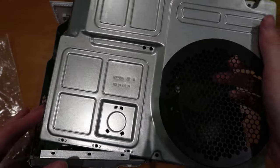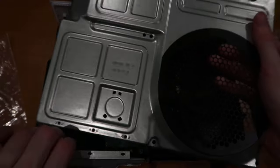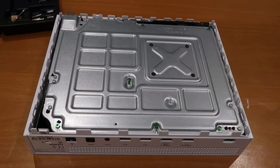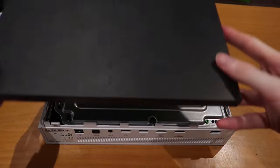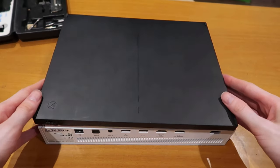Put your Xbox back together — basically undo what we just did. Don't forget to put all of the screws back in. Once reassembled, clip the plastic case back on using a bit of force; they can be hard to put back on, but it's nothing compared to taking it off. Then get a USB or an SD card with a USB adapter and plug it into your PC. We need to prepare the USB or SD card with the Xbox software. Here I am in file explorer with my SD card plugged in — yes, this does work on SD cards. Just make sure you have a USB SD card adapter.